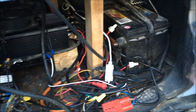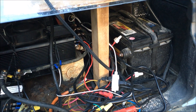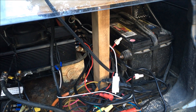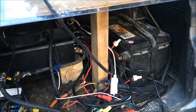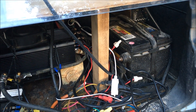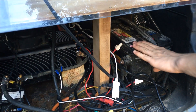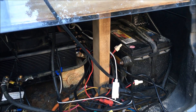This battery here is actually a 19th battery, but it doesn't propel the car, so it's not included in the battery count. This is the battery you would have in an everyday vehicle — just a 12-volt battery. It provides power to the lights, etc., and it helps supplement what's called the DC-DC converter. The DC-DC converter takes power out of the main batteries and puts it into this 12-volt battery so that it can run the vacuum pump, headlights, taillights, etc.